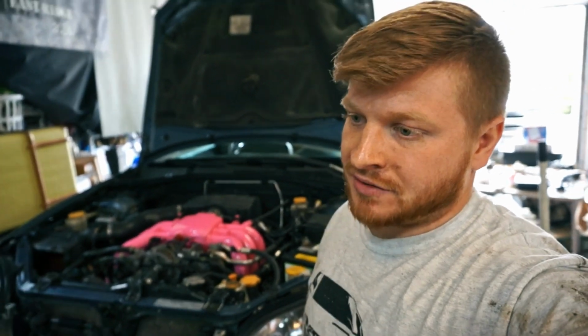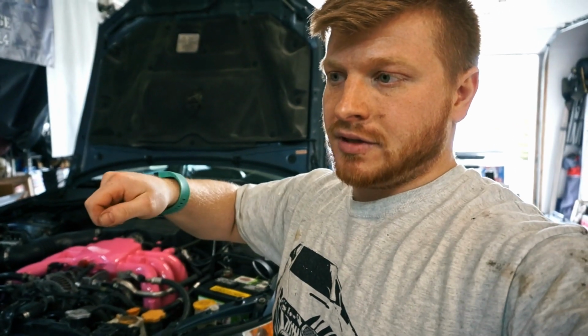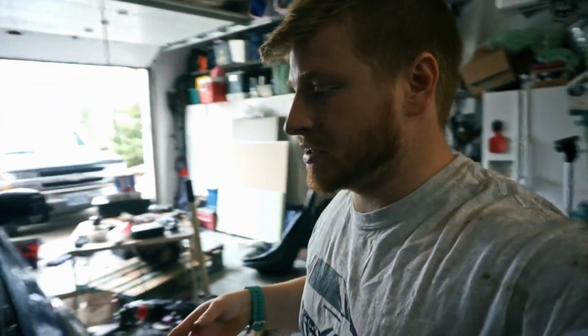Oh, yeah, so I had one more major mess up that I didn't realize. I've never had a car that had hand controls on the steering wheel, and when I had the power steering rack out, the wheel kind of flopped over onto one side, and then I guess I must have turned it around a full revolution. Anyway, I'm pretty sure that you can only turn that thing so much, and I'm pretty sure I stripped out the wires on the volume and the radio controls on the steering wheel.